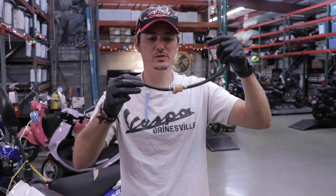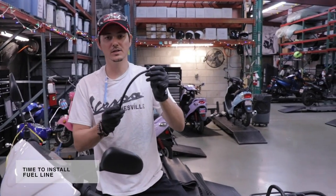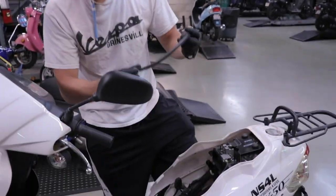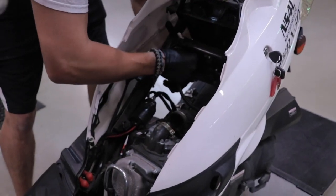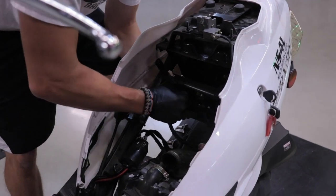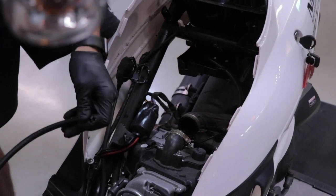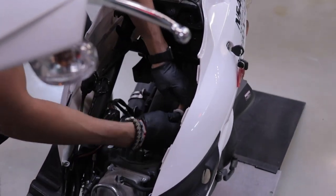You do want to cut the fuel line in a couple places to install a new fuel filter. It does have flow direction, so make sure you don't install that guy upside down — otherwise you won't get your fuel through there. I tend to cut my fuel line a little bit longer so I can make sure I've got plenty of room and I want the filter where I need it. Go ahead and put the filter in one end, make sure it's facing the right way, and then button up the other end to the actual fuel valve underneath the tank. The fuel valve has two ports — it's the one on the top. The bottom piece is the vacuum line. I'm just going to route that in and add my extra fuel line here — don't need much more, so I'll just shorten that. That's ready to go into the carb.